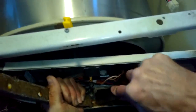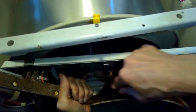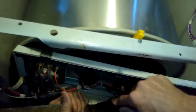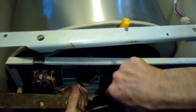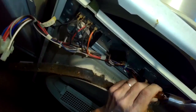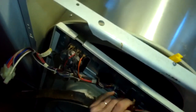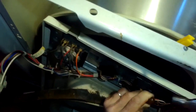Just working on getting that old one off — some of the glue on this one part is really stuck. These bearings are supposed to wear out: they have three plastic glides that wear out first, and after that it starts wearing onto the felt. The felt gets thinner and thinner, creating a bigger and bigger gap. That's when you get problems — you might get a squealing metal sound, but more often clothing, especially white clothing, gets trapped in there and gets a brown or burn mark.